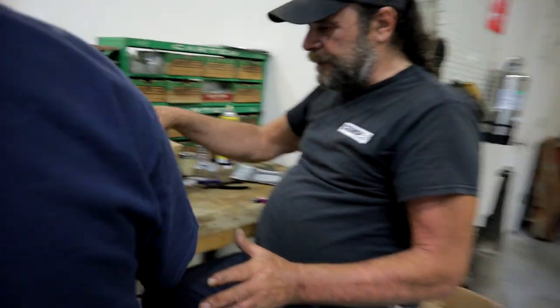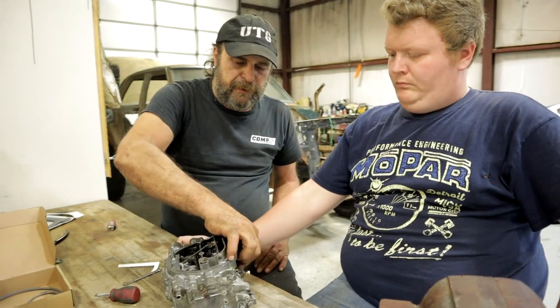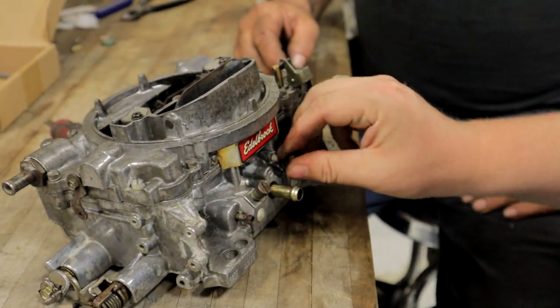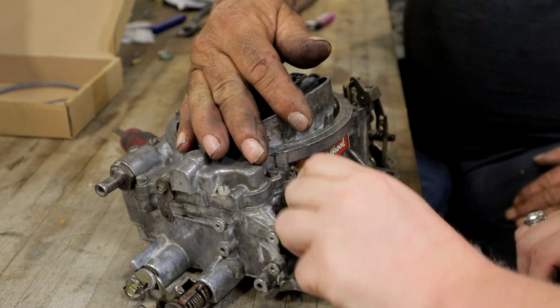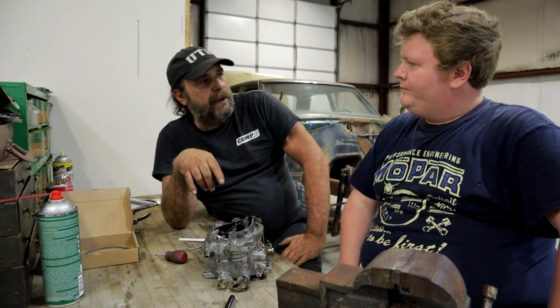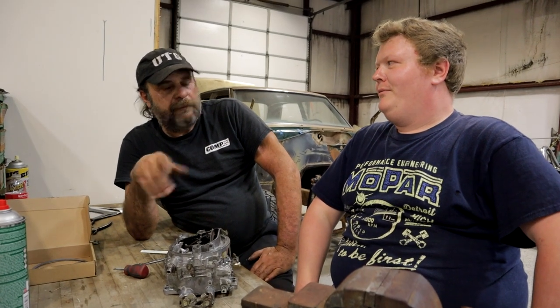This thing is together. We're going to start our adjustment with these screws all the way in, then turn them out one and a half turns — that's going to be our starting point. Thursday we'll stick this thing on the car, get our fine adjustments on it, and find out whether the old carburetor had an issue or there's a problem with the engine or the basic tune-up that won't allow it to take a proper sized carburetor.